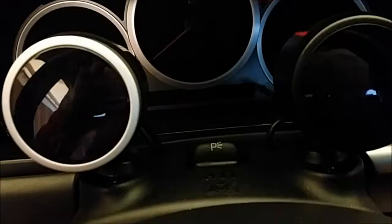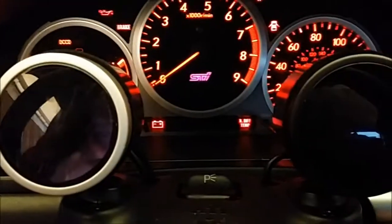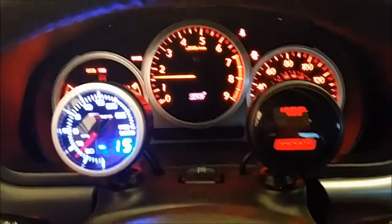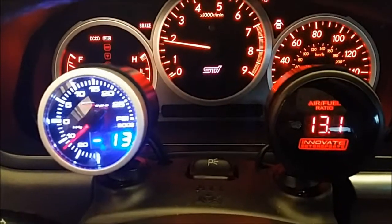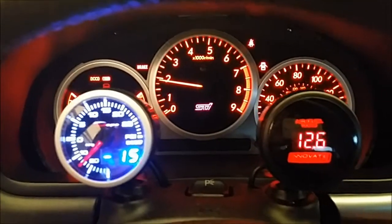It's been on for a couple weeks now. Let's see what happens — keep the fingers crossed. Might have to pull the battery and reset the ABS unit, but maybe it'll just correct itself. Boom. Gone. Light's off. Start it up and see what happens. I need to work on my cranking and warm-up tables a little bit — I'm running E85 and it's about 50 degrees out, so it's starting to get cooler. Looks like that solved it. I won't know for 100% until I take a test drive, but man, that's great. That light's gone. Got the axles back in. I'm excited now.